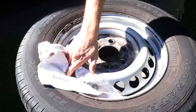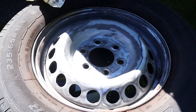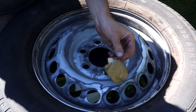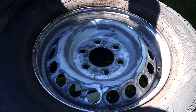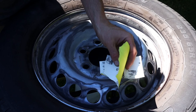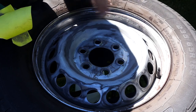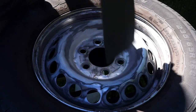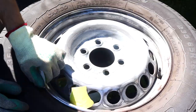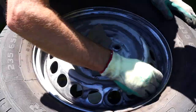Not only is vinegar good for fish and chips, it's also great for dirt and grime. I went over this with the wire brush and the electric drill — that got rid of most of the rust. Then I went over the remaining rust spots with 60 grit sandpaper and gave the whole thing a sanding. Now I'm going to go over that again with the 120 grit to smooth it out and get rid of any scratches, and then finally the 220 sandpaper to get a nice smooth finish. It's important to start with a coarse sandpaper to get rid of all the rust and then work your way down to finer sandpaper.